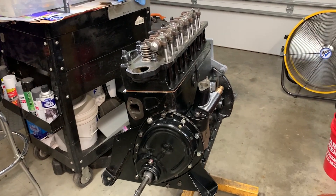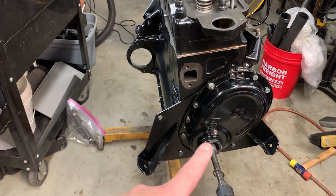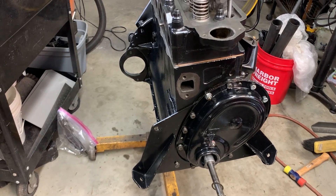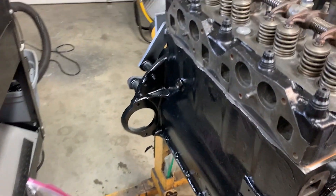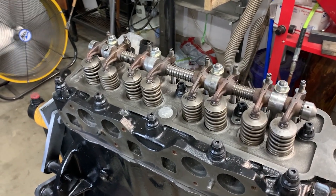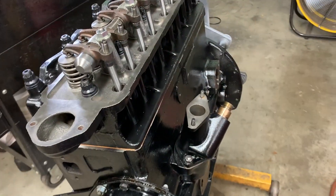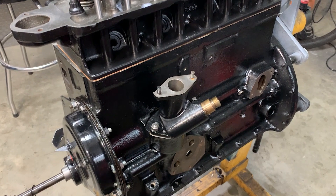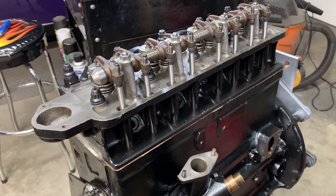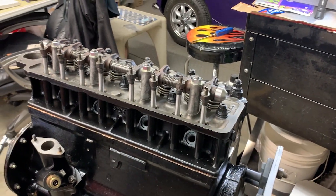Getting to the end of a long day. My accomplishments today were: getting the timing chain cover installed and sealed up, getting the head on, and getting the rocker shaft assembly on. That all looks okay — it turns nicely. The distributor pedestal is on and push rods are in. Everything looks like it's going according to plan.